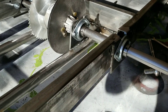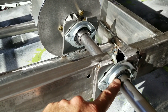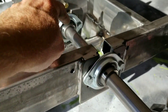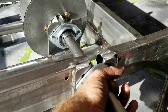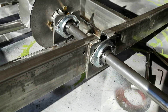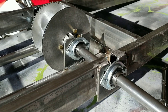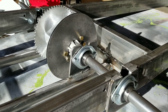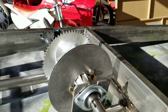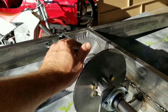The differential is installed and the bolts are tightened. Set screws are snug — these aren't over-tightened too much right now. When you do your final assembly, you want to use Loctite on all eight of them. You're also going to put locking collars on all four positions so this assembly doesn't slide around if any of these loosen up under vibration. One trick: progressively go around — I tighten the inside ones first. Make sure this thing spins freely; if it doesn't spin freely like that, something is a little out of alignment.